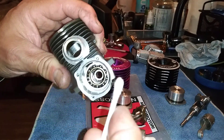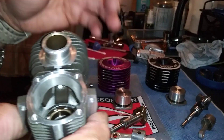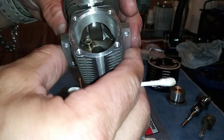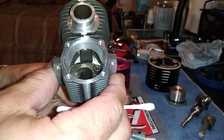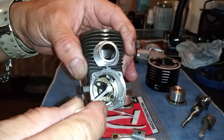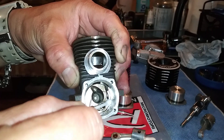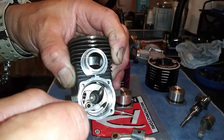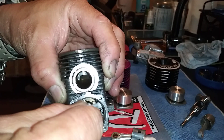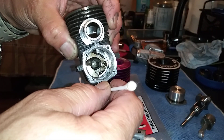There are videos out there of people doing this now. When you check inside without pulling your crank out - say your crank is in - put the crank back in and check to make sure your filter isn't letting dirt in. The best way to check is to take this swab and see where the crank is right here, this little gap where you can fit it in where the crank spins. Take it, put it in there, rub it in there, and it should be like a golden brown - see that? That's what it should look like.